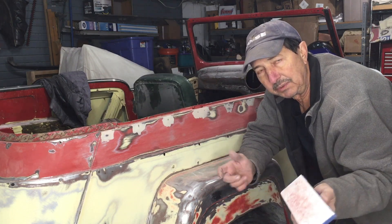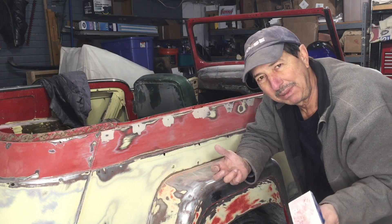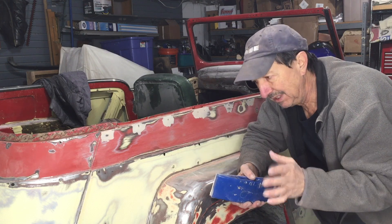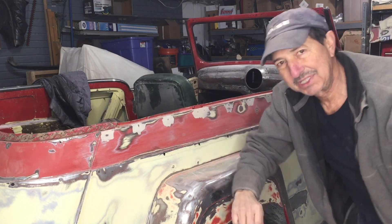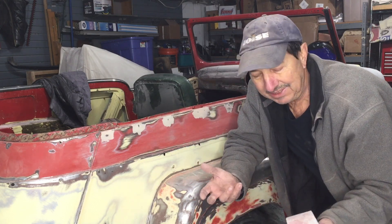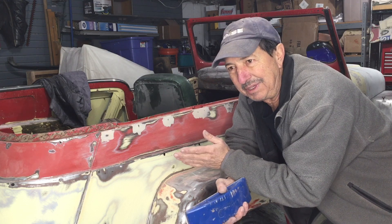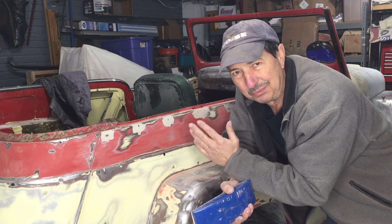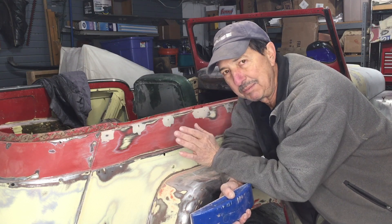I can do all of this with the DA and I did do a lot of it for my initial sanding just to see what problem areas I have — the DA does a pretty good job. But I find a lot more imperfections in the metal when I use a flat block. The DA has a tendency to just ride over those highs and lows, while the flat bottom block or a larger two-footer exposes those flaws. It would be okay on most paint jobs to go over with the DA and you'd have a decent finish, but when you've got long flat panels I want to see that reflection perfect like a mirror. It's a little extra work and maybe $200 worth of filler and 10-20 hours of work, but it's just worth it to me to guarantee these panels are perfectly flat.